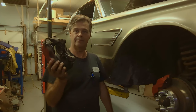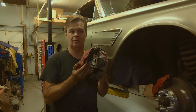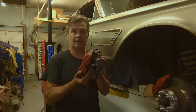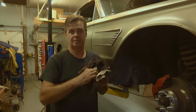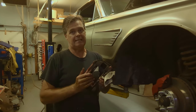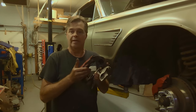Hopefully someone found that helpful. If they're struggling to get these pistons out and are tempted to put a vice grip on and crank them out, I can tell you up front, putting a pair of vice grips on these may work, but highly likely if they're stuck hard, you're not gonna get them out with a pair of vice grips. I believe there's a tool that will go inside the piston and open up so you can turn them out. If it's not super stuck, if you're just doing a rebuild because there's a leaky one or something, maybe that'll work good. But